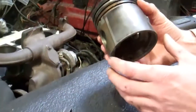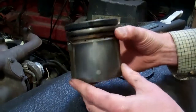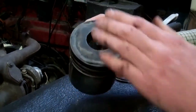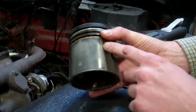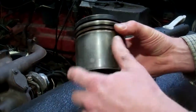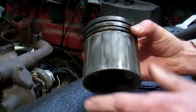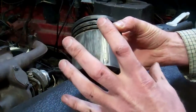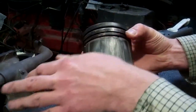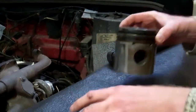So we took the pistons out. The pistons should look like this normally on one side — this is obviously the top face of the piston, which all looks relatively fine. The side should look like this; you can see you've got this sort of dark grey bit. But this one has gone like this. So at some point we think the engine's overheated — it's expanded and picked up on the cylinder wall. This was number three piston.